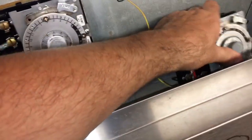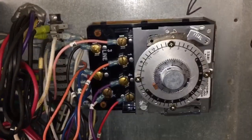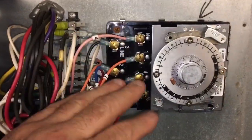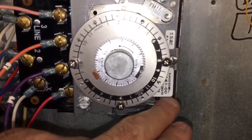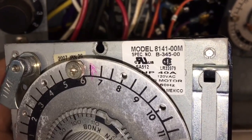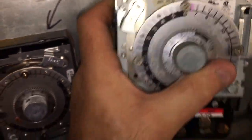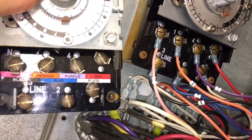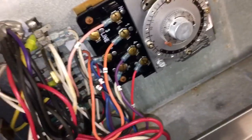Like I said, when they hit 10 years, you're doing everybody a favor — yourself and the customer especially. Anyway, replace them at 10 years. This is an 8141-00. The original clock is from a 2007 box — the M stands for manufacturer. You can see right here: January 26, 2007. The manufacturer color-coded the wires, and the new clock matches exactly — all the same colors. Beverage Air is pretty cool like that.